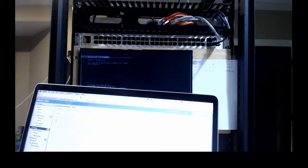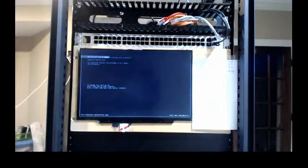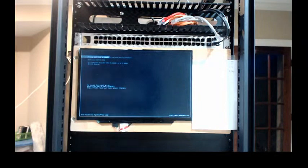Colossus Master Pool is the entire shared array. The entire array on that server is shared, and then VM Data Store is a subfolder that's also shared over NFS, and that is strictly the VMDKs, the VM disks and stuff. So if we go to Colossus Master Pool, we can go to OS ISOs, and we have our Windows ISO and stuff like that. So our NFS shares and our NAS are working the way they're supposed to, so that is great news.